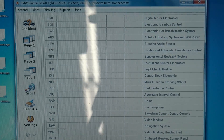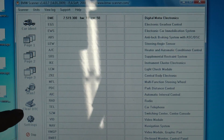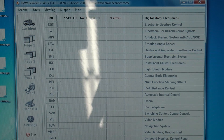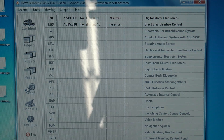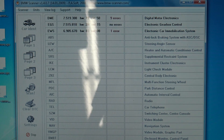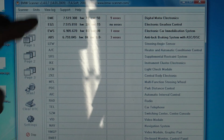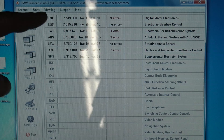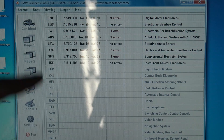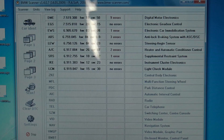What you want to do is hit scan. This will also let you clear your DTC codes, just to let you know. What it's going to do is scan each one of the computer modules in the car and come up with information about them and the number of errors they have. There are three pages of these modules — three pages of computers in this car. We only really need the modules on the first page. The other two pages are just miscellaneous stuff.